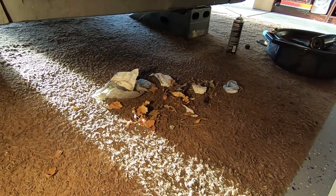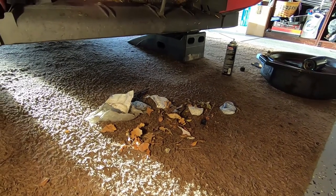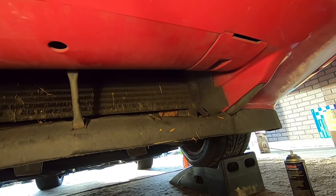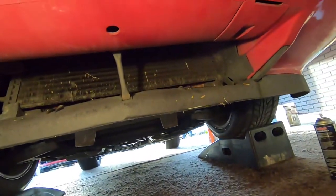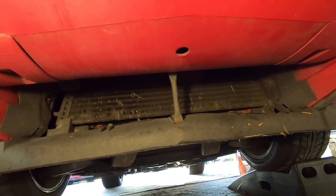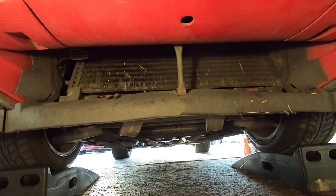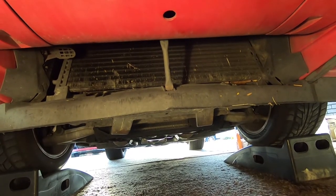While I was getting everything buttoned up underneath, I wanted to shed some light on something. You can see all of this stuff that was wedged up inside the radiator area up here — there's still a little bit I need to get out. If you fill all that up with debris, you'll start getting overheating issues. Every once in a while this car would act up in traffic and start getting a little bit hot. So while you've got the car up in the air, go ahead and clean that out — make sure you don't have any extra surprises up in there.